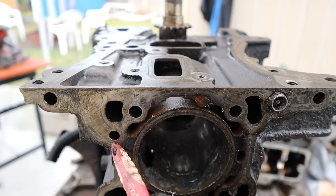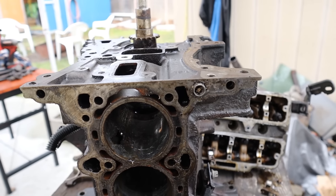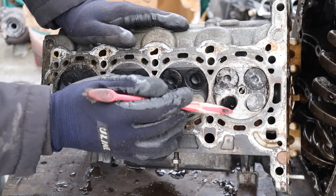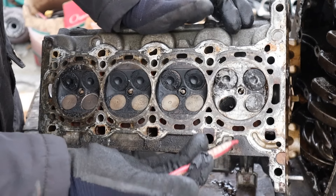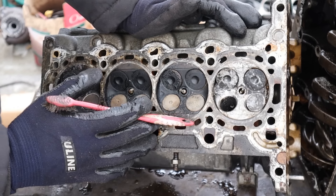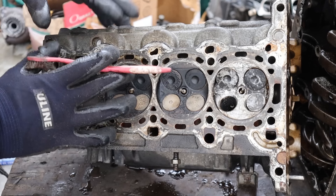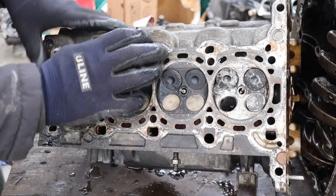Also, the top of the head here — you can see this is the oil feed that's going to go to the head, so you can feed the variable valve timing gears and lubricate everything up top. Looking under the cylinder head here, you can see obviously we've got complete carnage on cylinder number one — it's completely messed up, very rough. We've lost a valve and the spark plug. You really don't want your engine to come to this point where it completely explodes, because you can't really save any parts after. At least if it warps a little bit you can replace the head. But if you do find that you're starting to overheat, pull off to the side of the road. Also, cracked cylinder heads are a big issue on these engines, so if you are going to be doing some engine work make sure you clean everything off and have them inspected for any cracks.